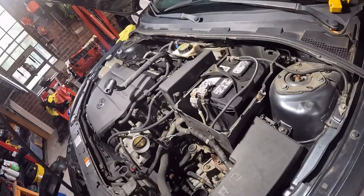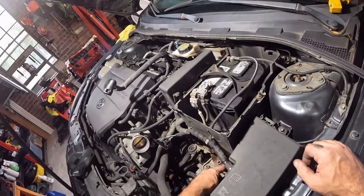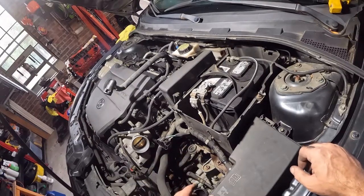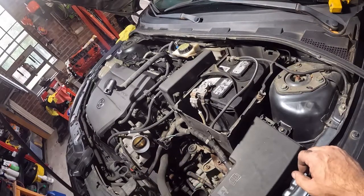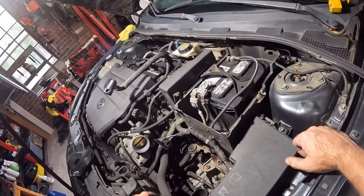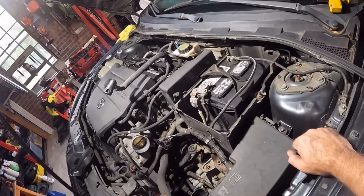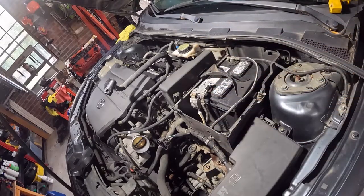So it does look like the battery tray has to come out, and you can see it right here. There's a little bit of corrosion, which I don't like. It's probably from one of the old batteries leaking. So I'm gonna take the battery out and we're gonna treat this area for corrosion, spray some rust reformer on there because we don't want it to get too bad. And yeah, so we added a little bit of time to our work here, but in all, it's for the best in the long run. So, all right, let's get this battery out. Get the rest of this apart.